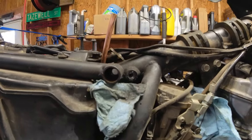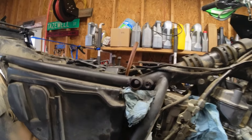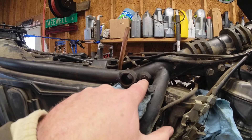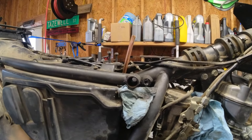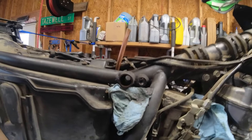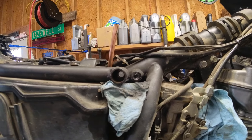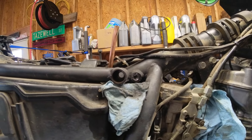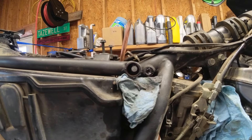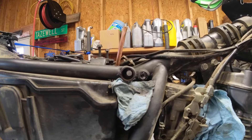Making a little bit of headway. I used this bit on my Dremel and was able to grind in there pretty good. I noticed what looked like a little crack where I was grinding and could feel the bit catching, so I took a punch, put it up there, hammered it, and it knocked out — I'm pretty sure that's some of the bolt and the broken easy-out. Now I'm gonna start with a smaller drill bit, see if we can drill through some of this bolt, then keep stepping up drill bits until we get it all out. KLR owners: replace that bolt before it breaks.